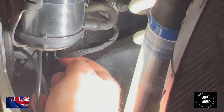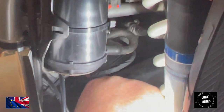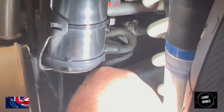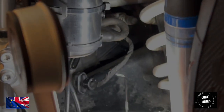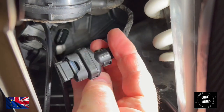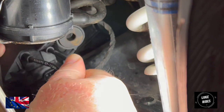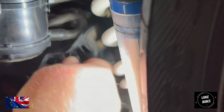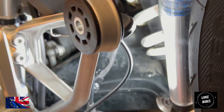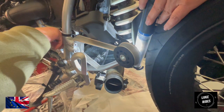The servo has come back and down and there's the loom that the servo buddy is going to connect to. We're going to get this off in order to release the servo. I've used a pick to remove the terminal, and then out comes the servo. With that one undone, the valve assembly will come up — there's the butterfly valve.